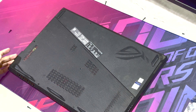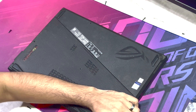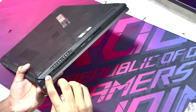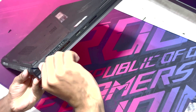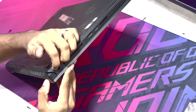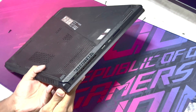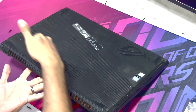Now comes the tricky part — which side to open from. Based on my experience, I've taken this apart multiple times, and you always want to start from this side: the right side, the side with the SD card slot. Put something in between the vents and try to pry it open. As you can see, it's already coming off — this is just to give you some leverage to pop the hooks open. Once you get some leverage, you start prying from there. If you have any cards or plastic, you can put it there to help get it open. You want to open this side first, then go around the other side.